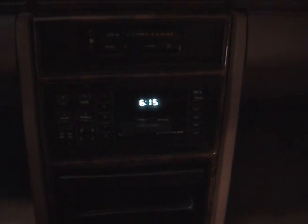These units were available with an optional CD player. Obviously I don't have the CD player and I don't want one because the CD is also an old-fashioned medium. But to enable the radio to play CD, there's an auxiliary input in the back of these units, which I use to connect a cable that ends here inside the armrest to a three-and-a-half millimeter audio jack.